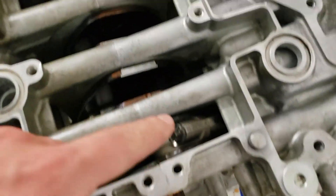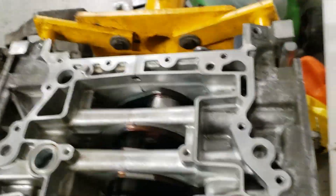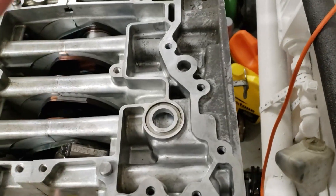So I probably should have showed you this before I put it away, but this rod is in and that piston is in right there. So obviously the new rings fit. When I went to put it in the first time, the rod kind of rotated and got a little stuck in there, so I had to pop it out and redo the process. But obviously they do fit now. So that means the problem was indeed with the DNJ piston rings. I'm going to reach out to Partsology and let them know that those rings do not fit this car. I saw somebody else commented on Amazon saying they didn't fit their car either — they had the turbo FA-20. So clearly these probably don't fit any Subaru motor, unless maybe you have aftermarket DNJ pistons. Anyway, I've got to put the rest of those pistons in. It's late now, so I'm going to do it maybe tomorrow.